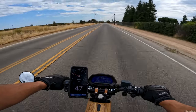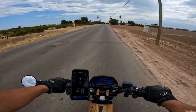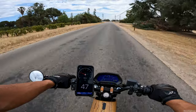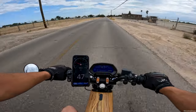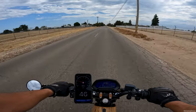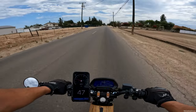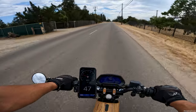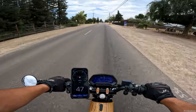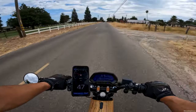I'm really curious to see where my voltage is going to be after these miles, because when I used to ride to work full throttle in traffic — which is what you guys want to see, real street riding — my voltage would get really low. I think it was like 76 volts for six miles, which means I was getting about 18 to 20 miles, just like Onyx says in sports mode. That's fine, but it was horrible for range anxiety. Now I can just go across town, have fun, take it a little easy on the way there, save the battery, and haul ass on the way home.